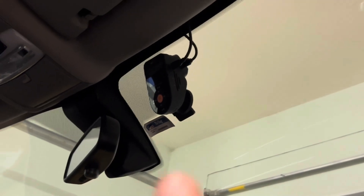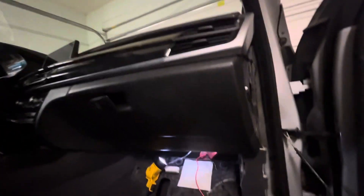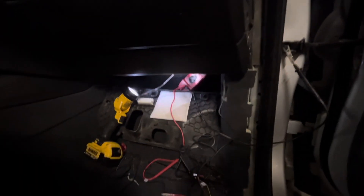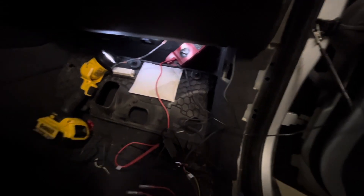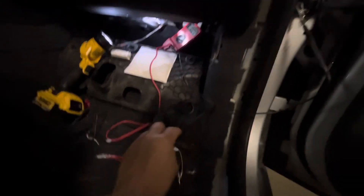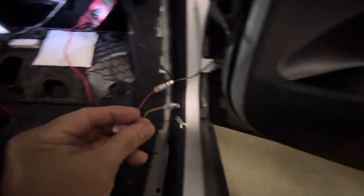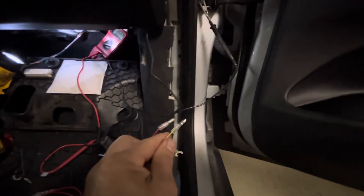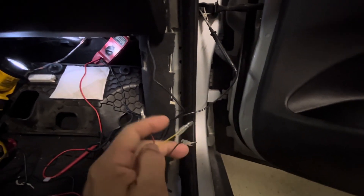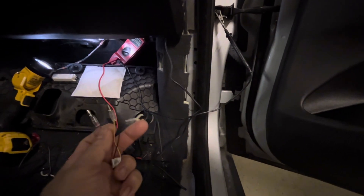You can see I've got my camera already hooked up and ready to go, with the rear camera already installed. I'm trying to hotwire it so it's going to have a constant voltage, taking video at all times whenever it detects movement from that particular camera. When you buy the hotwire kit, it comes with three leads: the negative, the constant power that's always on — that's yellow — and then the red one, which is the ignition.